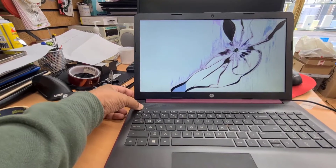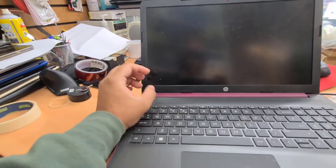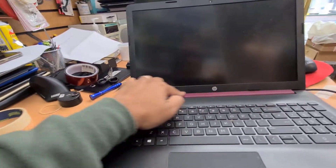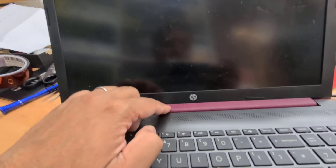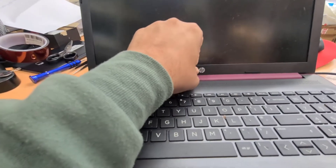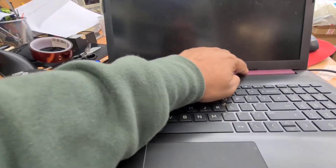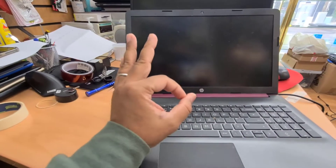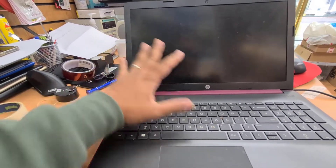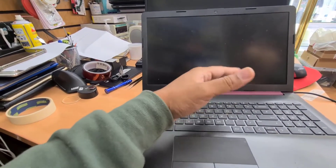There is really only one proper way. The front frame — called the bezel — comes with two hooks at the front, like a plastic cover which covers the hinges, but this one is flat. This buckle and the black part are separate, but if you try to pull it from the front it's going to be very difficult and cause damage. The proper way is to separate the screen panel from the board by opening from the back cover.